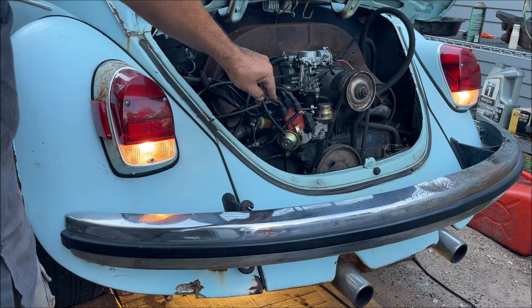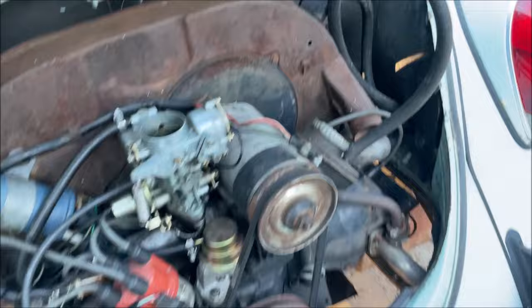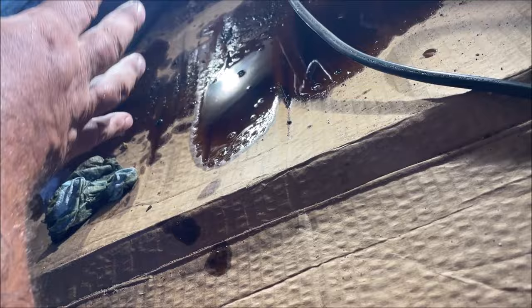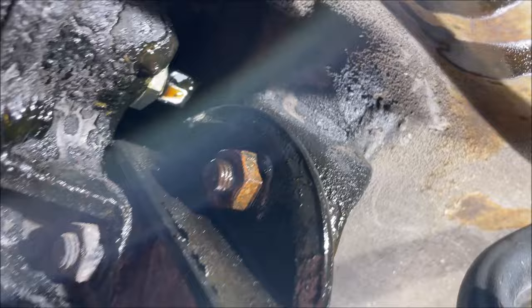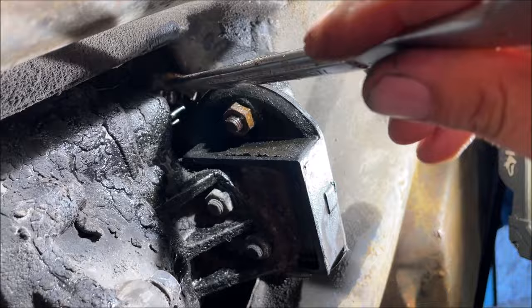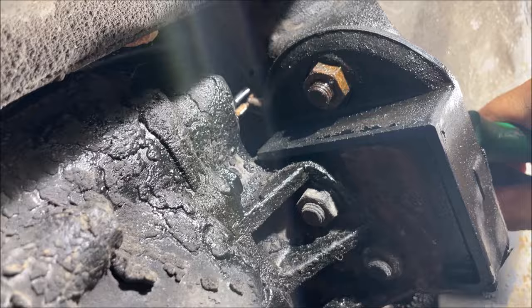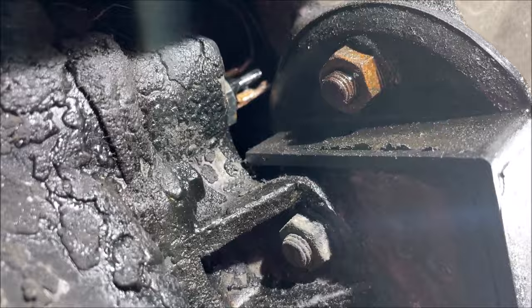Inspect it because the wire goes up by that axle - I saw something on there earlier, so just inspect that and fish it back in. What messed me up was that little washer fell out. I spilled about half a cup - it just looks real bad because it's already absorbed in, so be careful. I went back and rerouted it over the starter so it's not dangling down by the axle. Got the wrench on it, tighten it up real good. It had a washer in it - make sure you put the washer back in. Got the wires on - beautiful, done.